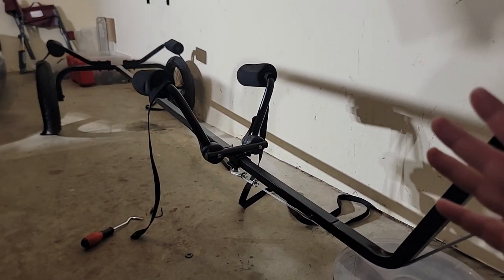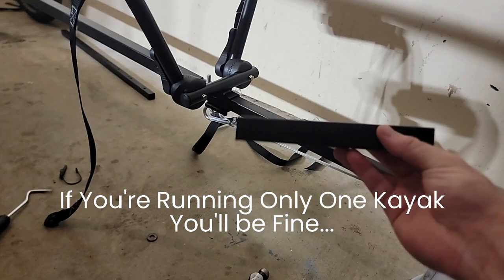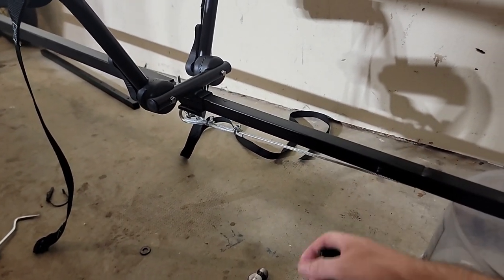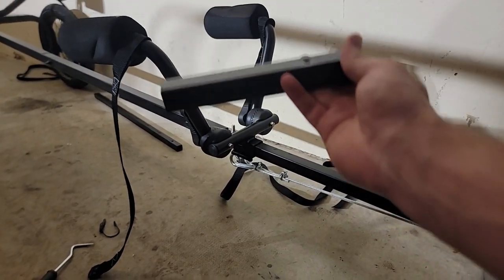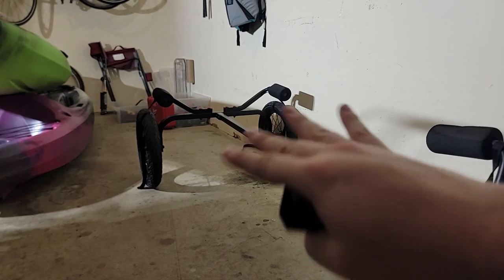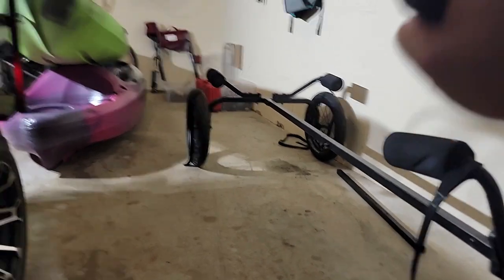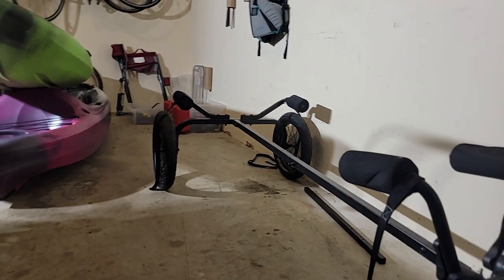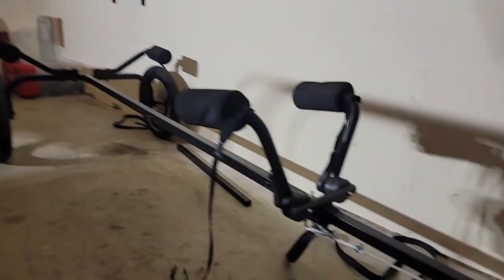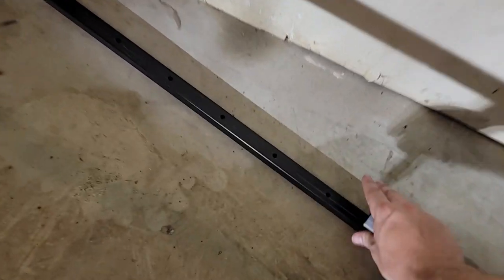Some modifications need to be made to get this thing to actually work. I cut about eight to ten inches out of this second piece here — I really needed to shorten the overall length to get some of the sag out. I pushed the kayaks as far back over the tires as possible, because I think distributing the weight over the tires makes the most sense. Cutting this section out seemed to make a pretty big difference.